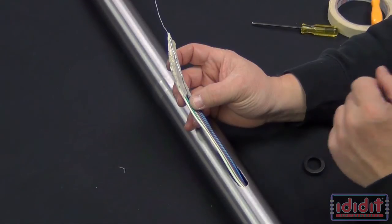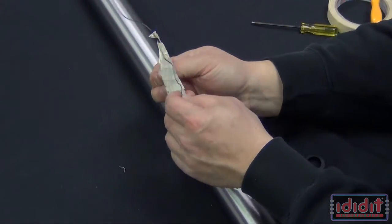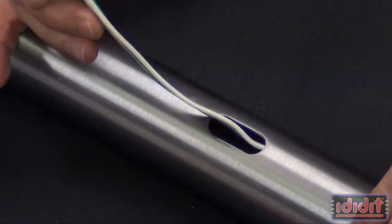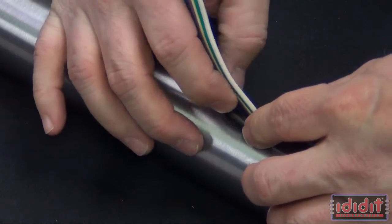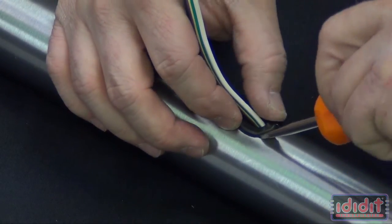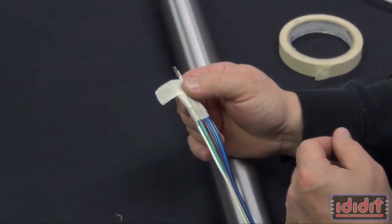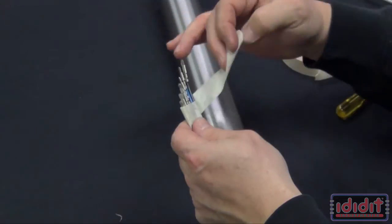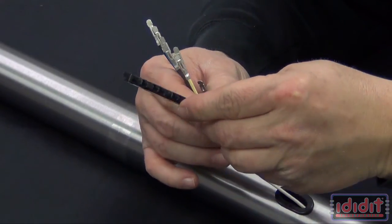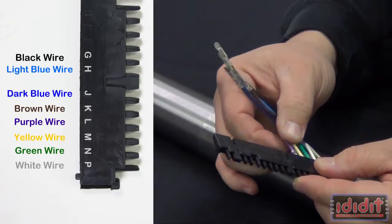At this point we can take the pull wire off the taped harness — just pull the tape off and release the harness from the hook. Set that off to the side, and now we are going to reinstall the grommet. If you put the grommet over the wires while they are still taped, it makes it a lot easier. This should just slide right into place; you may need a flat head screwdriver to help. Now remove the tape from the wiring harness and reinstall the wiring plug. The wiring plug is lettered, starting with letter P with the white wire and working all the way down to the black wire, which is letter G.